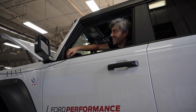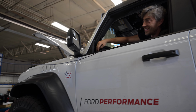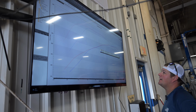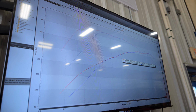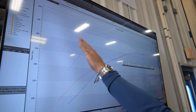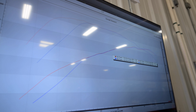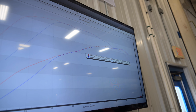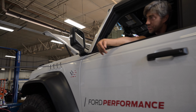324. I mean, at least the vehicle's consistent. You can say that, look at that. Just crazy how much torque this thing just jumps up. Yeah, you can see I jumped on it a little later. So that's why down low, below 3,000 RPM, that's not relevant. That's just me rolling onto the throttle later versus the first run. And again, less load without all wheels spinning is gonna spool the turbos later than it would. Yep, so it just came in a little later.